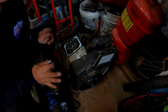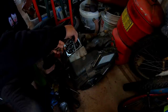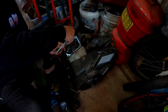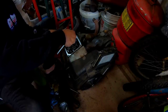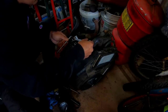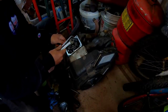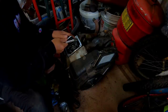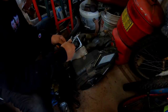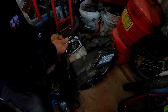I found top dead center. I think it's the compression stroke. I loosened this torque thing over here. So being that this is the exhaust valve, I'm turning the inner one to tighten it. And that seems to be it. And now you actually do the opposite by tightening the outer nut, whereas usually it's tightening the inner nut that would get it to work. It's the opposite of that kind. So that's a good drag of 6. I'm tightening the inner one. Good drag. Wow, I don't know why I can turn it so well.